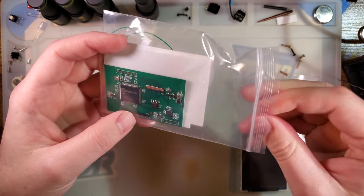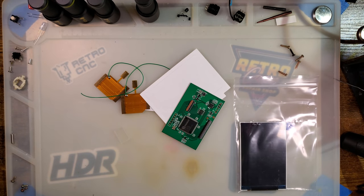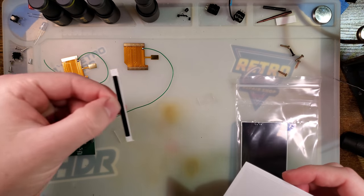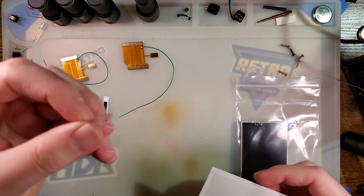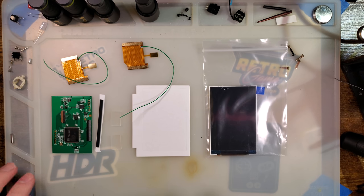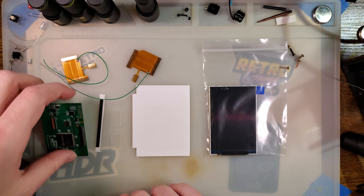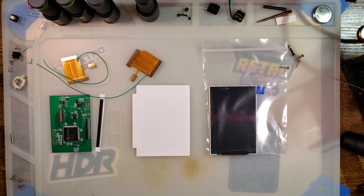The kit itself uses more or less a brand new converter board. The previous iteration of this kit — I'll have the video linked in the description — uses a little bit of a different setup. This new kit comes with the converter board, three spacers — one black foam spacer and two hard acrylic clear spacers — and some adhesive to attach the screen into the Game Boy. The previous iteration did not have a wire on the ribbon connectors. This one does. This one requires soldering, it requires some external power; it can't just pull everything it needs off of the LCD data bus like the old version.